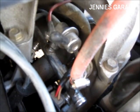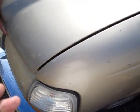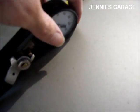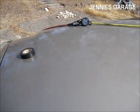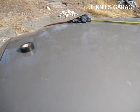The next step is to route this gauge somewhere that the driver can see it. The only suitable place I could find for the hose to come out of the hood was right in front here — everywhere else the body seams are too tight. So I put my hose through here and taped up the gauge assembly so it won't scratch my paint. I used some bungee cords to tie the whole contraption up over to the antenna base, so now I have a gauge that's visible from the driver's compartment.